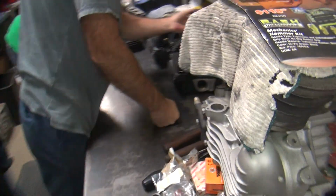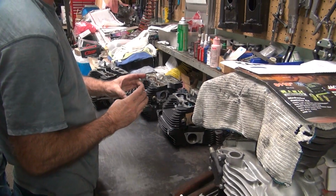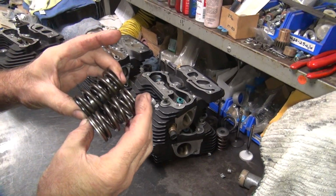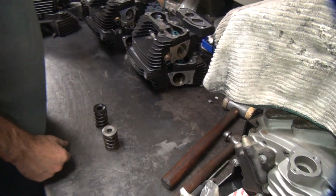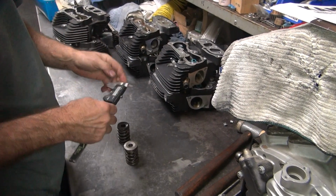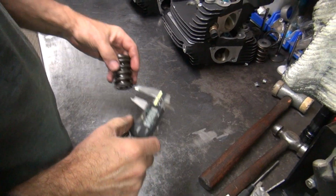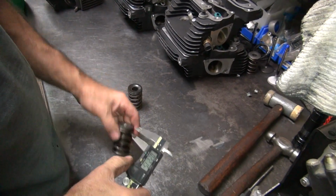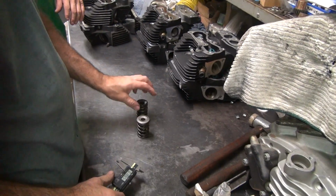The first thing I do is figure out what kind of tension we got on the springs. Which one has more tension? I wouldn't know. I'm learning, I'm just in apprentice mode. I like the inner springs on that one better. Well, this is 193 thou wire. This one's only 185. Well, then the one on your left.